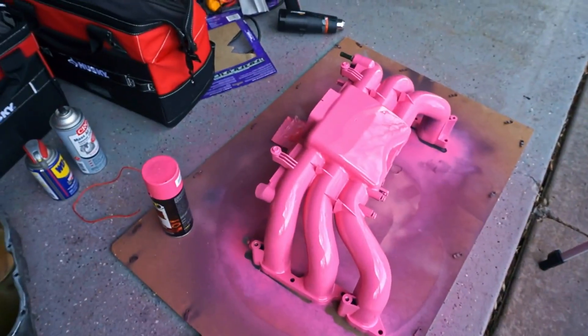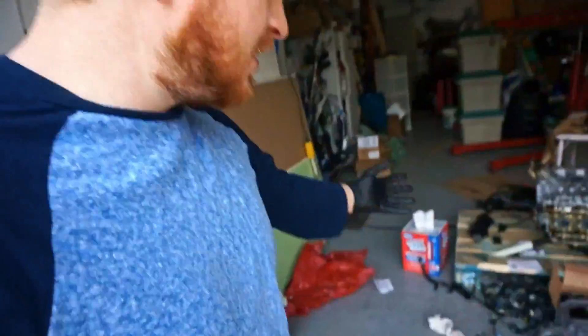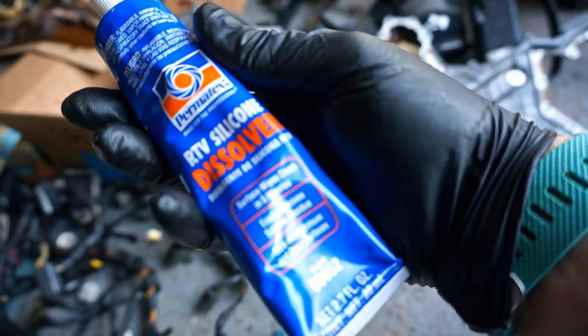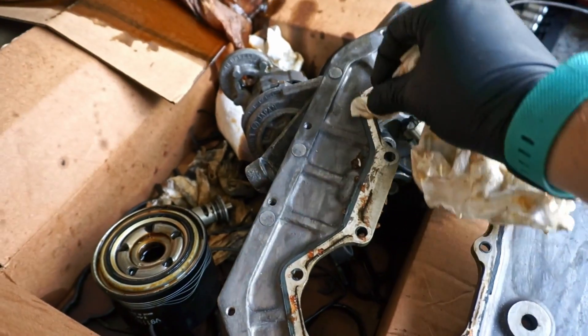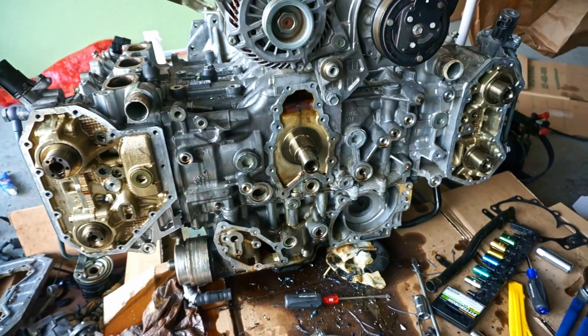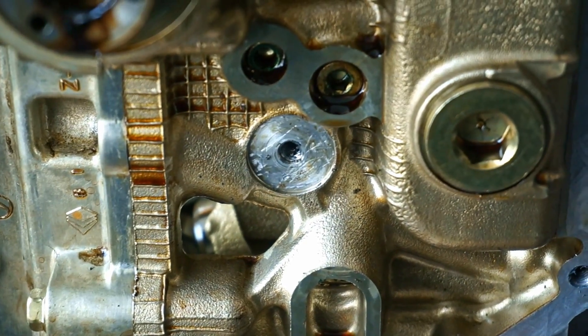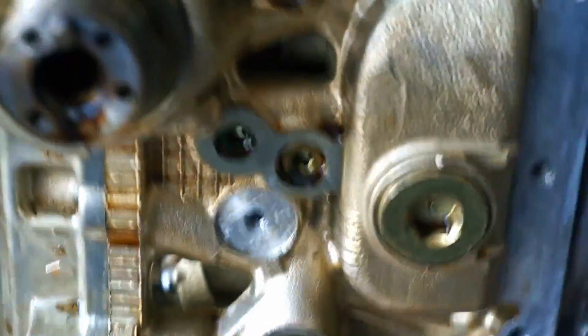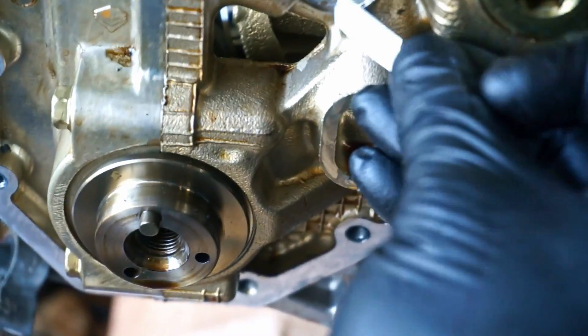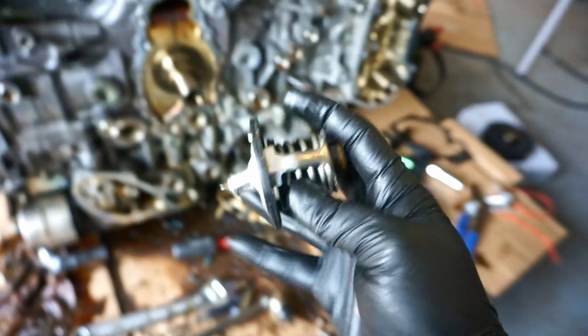My wife's happy with it too. I tried using RTV Dissolver by Permatex — this stuff does not dissolve RTV. I come up here and it doesn't even make it soft or anything. Here's the front of the engine — I got all of it cleaned up, the RTV is off all of it. The hard part was right here: that little gap gets filled up with RTV and it's too small to fit a normal razor blade in there, so I busted off a piece and used that to scrape it all off.